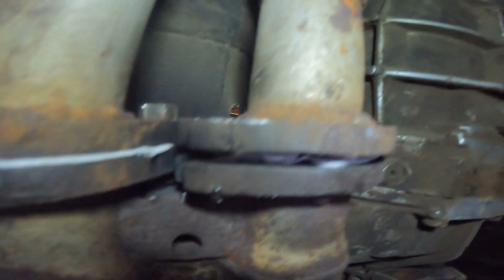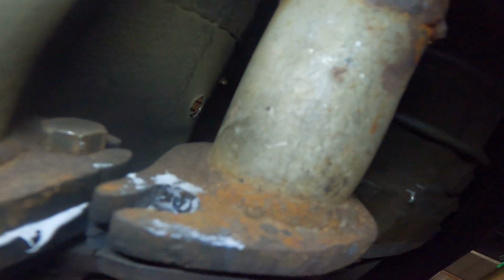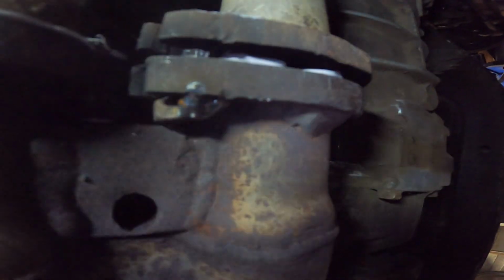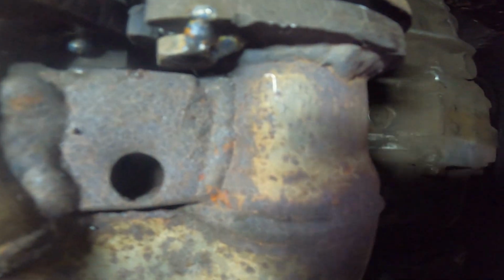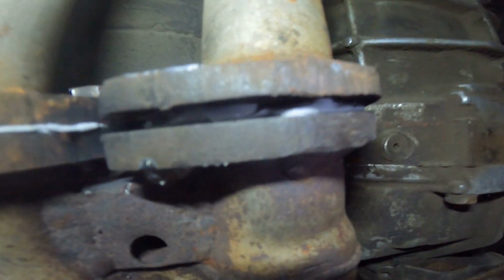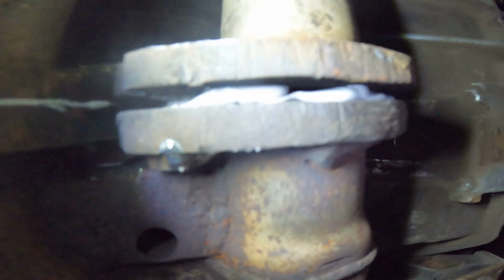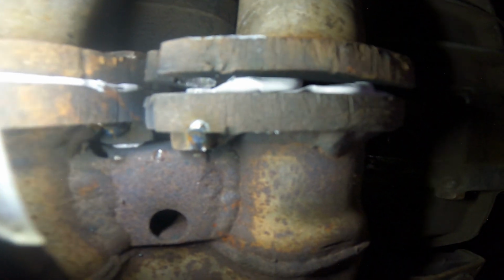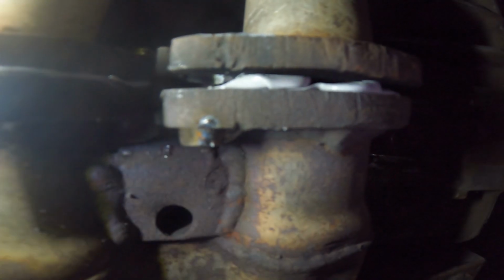Alright, so we're now at the point where we've made a right mirror of this. So apparently that's on too much of an angle that it doesn't line up with that side. So we're now going to try to stick a 12mm through there instead of a 14. But Corey's just cutting the washer off the 12mm so we can press it through there, get it under that side, and hope this pulls tight, because that is not going to seal whatsoever, no matter what we do, unless we can try to get it to pull tight.